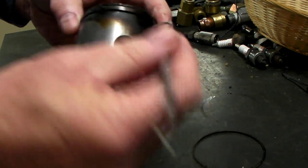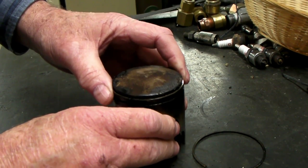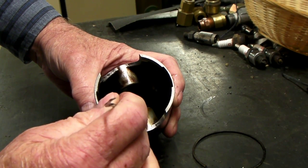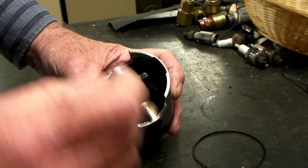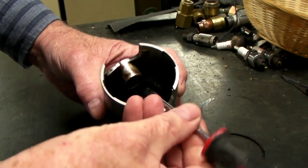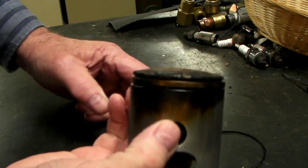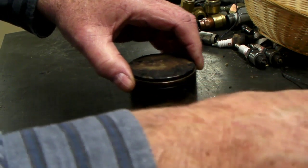It's just a matter of using my dental pick to go around and clean that carbon out of there, but I'll soften it first by putting it into some carburetor cleaner dip. The other thing I want to point out is you get a lot of carbon on the back side of the piston. These chunks of carbon, if they come off, can get down in the crankshaft — that's not good for your bearings. You've got enough stuff flying around in that engine without worrying about pieces of carbon going into the crankshaft. The oil flings off the flywheels, hits the hot piston — that's what forms the carbon on the bottom. A lot of people don't realize they've got to get that carbon out from underneath that piston, and you don't want hunks of it going into your crankshaft.